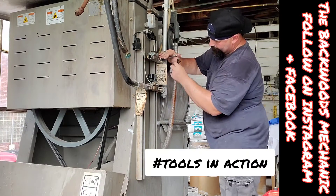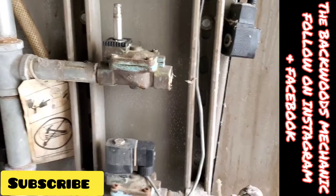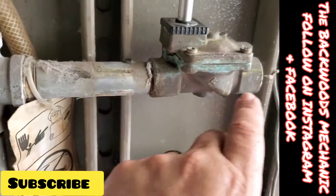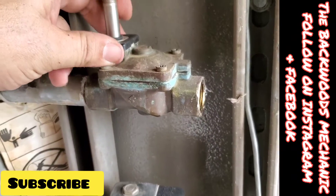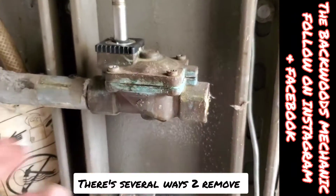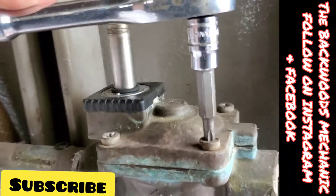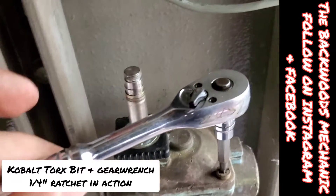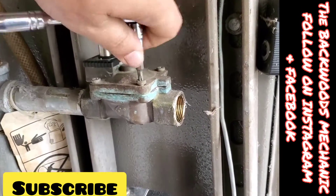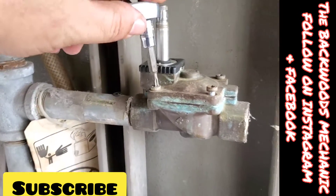This one's a little bit rusty. I'll give you an up-close look while I'm taking all this stuff off. We got our three-quarter inch pipe off, now we got to get our actual water valve off. Got our solenoid off, so we're going to take the cap off this so we can get a good hold and twist it. If it don't come out, we'll just take the whole pipe out. We got our Cobalt Torx right here — this is a T25 — and of course our old GearWrench, old faithful. Ever since I bought that little set, these GearWrench ratchets have been perfectly fine — you can tell this one's been through some hell and back.